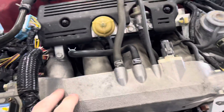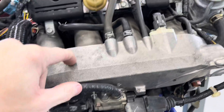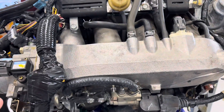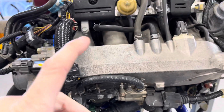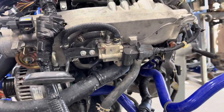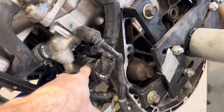Hopefully I'll keep the fuel rail attached to the manifold — the fuel rail is under here — and keep a lot of these hoses on just to keep track of everything. I won't be doing anything with the intake manifold besides replacing the intake gaskets to the head when I put it back together, so the rest of it should stay together and complete. Coming to the back of the motor, there really isn't a lot to do back here for the moment except pull the starter off.